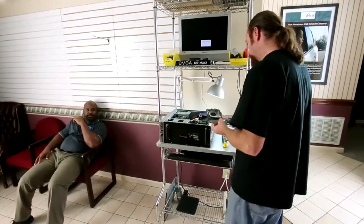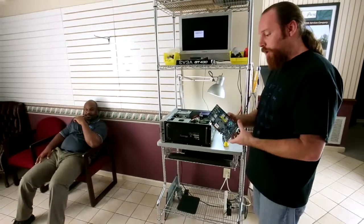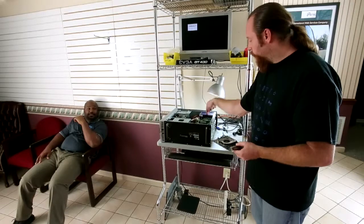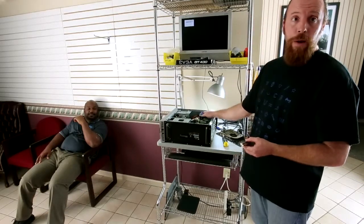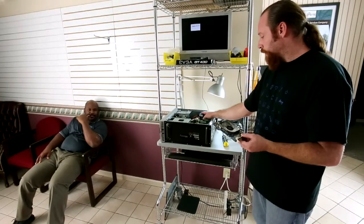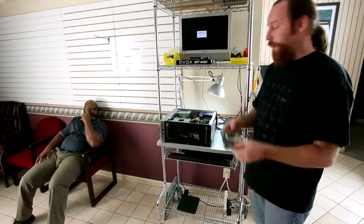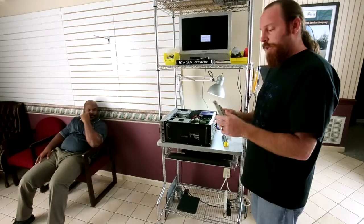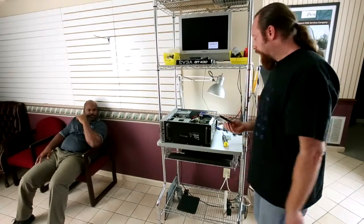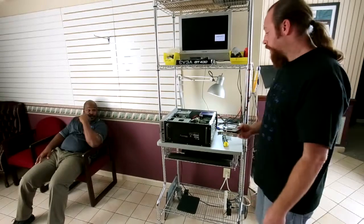Putting it back in is really simple — there's really no screws except for the one right there. There are no wires to connect unless you buy a really high-dollar video card. If you do buy a high-dollar video card, you'll want to make sure it's compatible with the output of your power supply unit, or PSU. Your PSU is going to have to produce enough power to run everything currently on the computer plus the new video card. Upgrading to a separate video card like this can make your performance increase by 30–40%. It's almost like having a new computer.